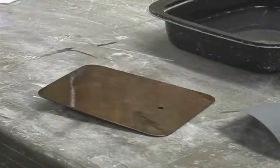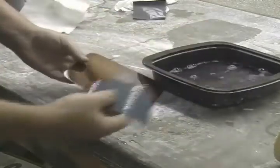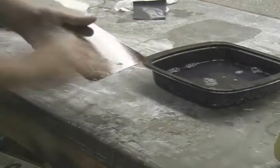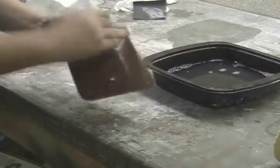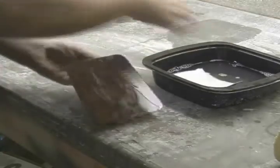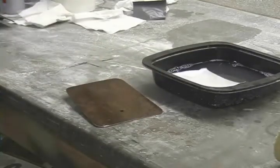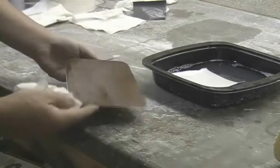We'll just speed this up — there's really not much to it. You just want to sand any nibs out and get your part dull after the last two coats of clear have been applied. If you're on a complex part, just don't sand into tight corners where you can't get your buffer. Unless it's absolutely necessary, you might have to do some hand buffing. That's pretty much it.